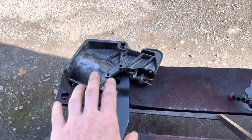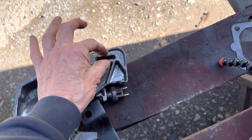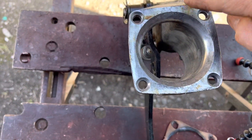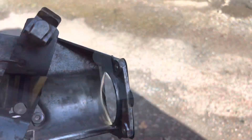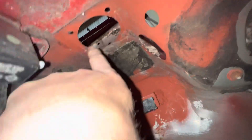When you come to put all of this back together it's easier if you put the pedal in first before you put the brake booster in. Put some grease in there because that hooks over a metal fitting, and on top of the metal fitting is a bit of rubber — it's much easier to get that on if you've put some grease on there. Similarly, I'm going to put a dab of grease on the gasket to help it stick on. We can now turn this whole pedal upside down without the gasket falling off. It's quite difficult to film lying upside down in the footwell, but the brake pedal is basically going to hook over that metal fitting there.